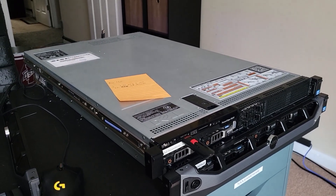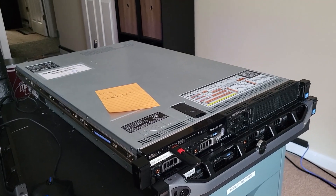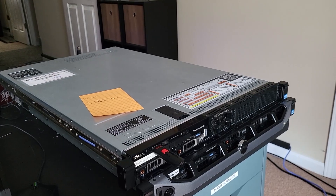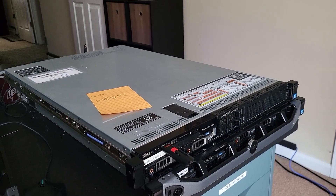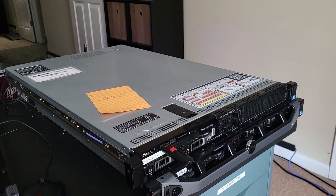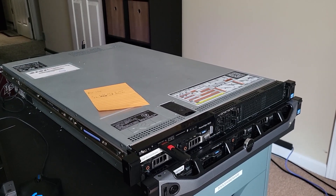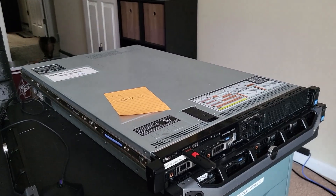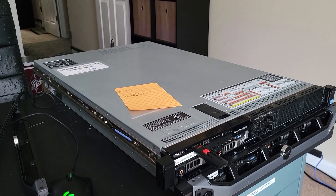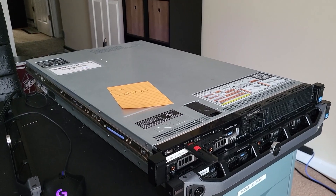And that presents a problem for me. I forgot that Dell servers have an integrated RAID controller that can't just be used as an HBA — you have to do RAID. So I'm in a little bit of a pickle. I could just straight up put in one of my spare LSI HBAs, but if I do that I won't have enough to connect an external HBA to a data shelf and also a 10 gigabit NIC. So what am I to do?